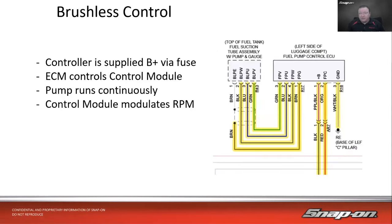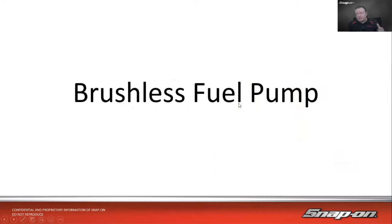And then we have the newest kid on the block — the brushless controller. This is totally different from anything we're used to. It has an actual computer that controls it, with battery power and a signal from the PCM for fuel pump control. On this vehicle it's just a 12-volt pulse — basically a square wave. The harness going to the pump on a 2018 Toyota Camry has three wires labeled V, U, and W — the three phases — plus a ground. Three phases control how this motor works.